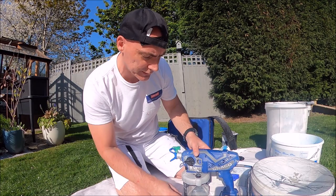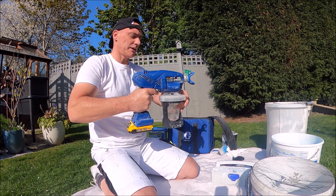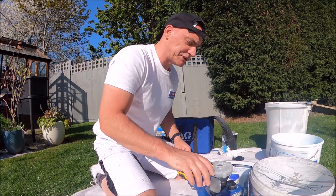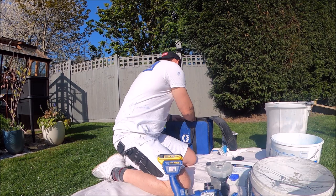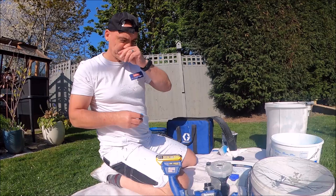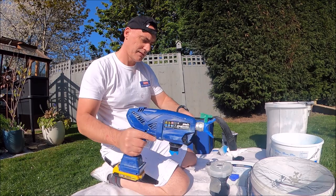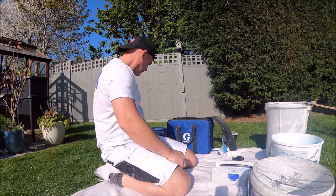I'm not going to run all the water through, so I'll release the air cap — that's actually broke but it still goes on. Twist it off and make sure the filter is still in there. It's a good job I checked — the filter is not actually in there. There's a fine filter here that goes in that position. Let's also make sure the filter's not in the bottom of the cup. We can empty this water out anyway — this screws off like so.